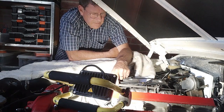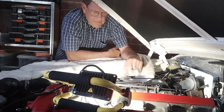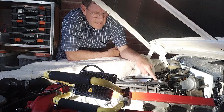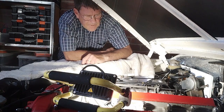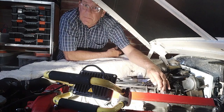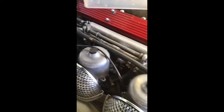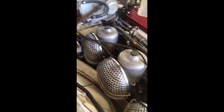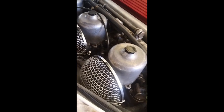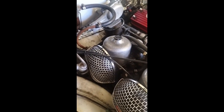From what I've read, the idea is that you decouple the three carburetors, set the butterflies individually to make sure the airflow is the same, then couple the carburetors up again. But in this case there's no way of decoupling them. Here are the three two-inch HS8s — there's no room for a conventional air filter, so it's got three ram flows. The carbs have been rejetted to make them slightly richer because they have more airflow capability.